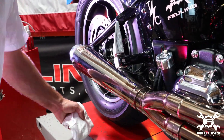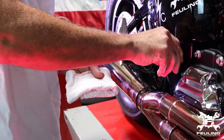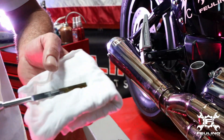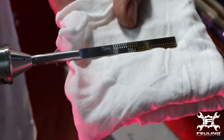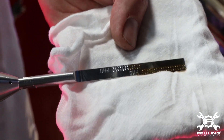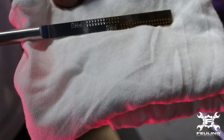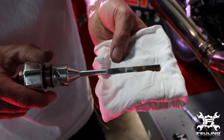We're going to show you checking the oil with this dipstick. We have both readings — upright and side stand. FHU is full hot upright; FHS is full hot stand. We highly recommend running the initial cold start-up three to four dots down, and then checking your hot temperature.